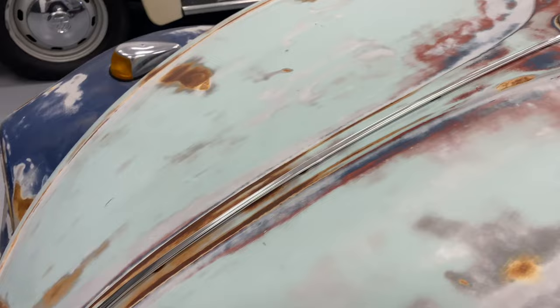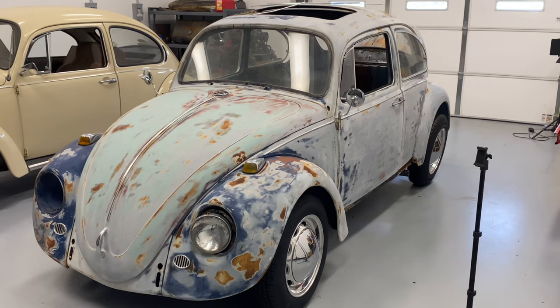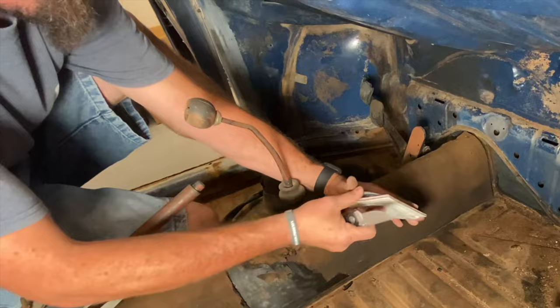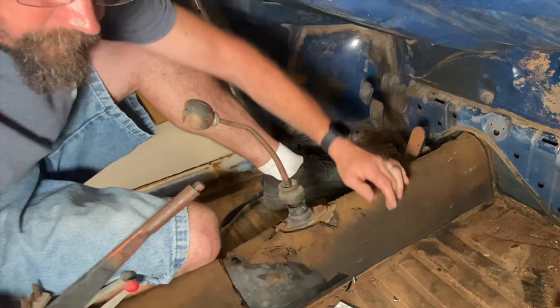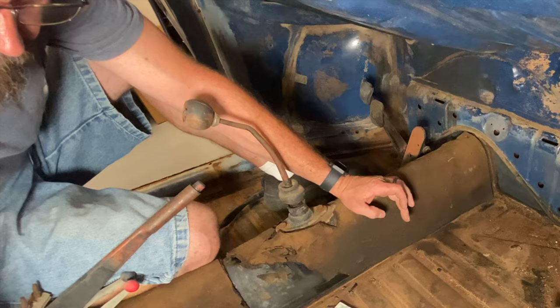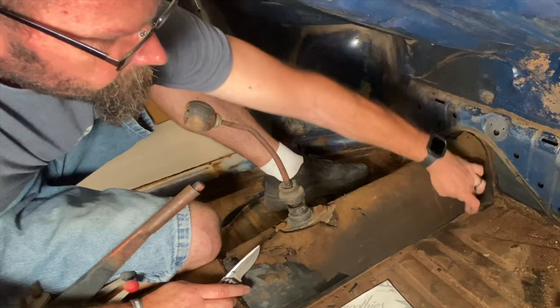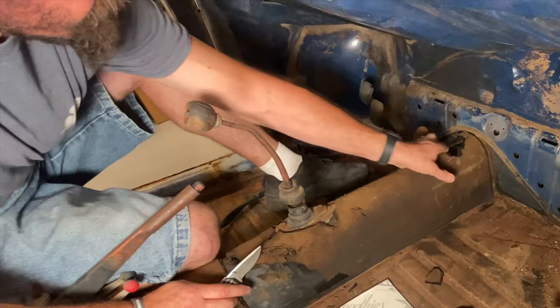We've got that shiny hood emblem, and I trimmed down those boots as well. So what if it's patina? Doesn't mean we can't have a little bit of class, right? If anybody watched my Super Beetle restoration series, you'll notice that I cut a hole in the side of the tunnel and made a custom plate so that I could access the clutch cable easily. People have been doing this same modification in off-road cars for years. Air-Cooled put together a pre-made kit with instructions you can download. Basically, all you're doing is measuring back, measuring up, cutting a square that then gets covered by a plate. I'm going to get working on that — and that starts by getting rid of all this old tarboard.